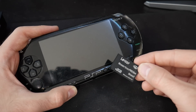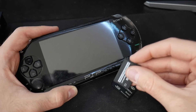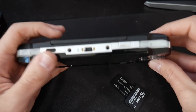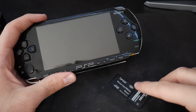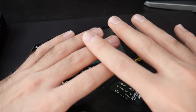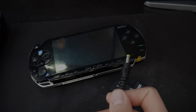Since we're accessing our storage we need a method of accessing it on our PC - either a memory stick pro duo to USB adapter, or one of these adapters with the micro SD card, or just plug it into your PSP and connect through mini USB. Either way, we need to access our storage on the PC. Oh, also make sure you have power available - get your charger ready, you're going to need it.